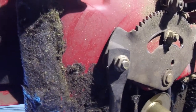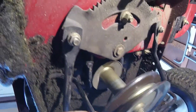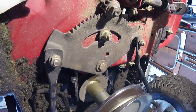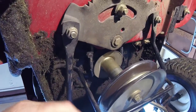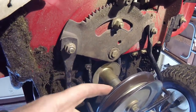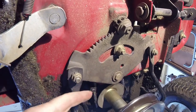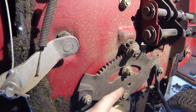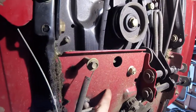As you can see around the crank pulley there's a really close belt cover, which means this pulley is going to have to come off or at least come down an inch or two. So in the steps: this cover has to come off, the pulley has to come down, slip the belt off the pulley, and then as you can see it comes around the steering shaft.